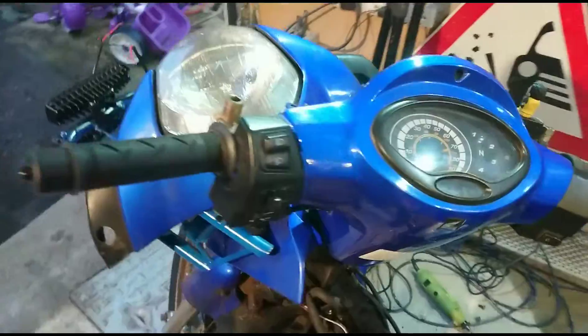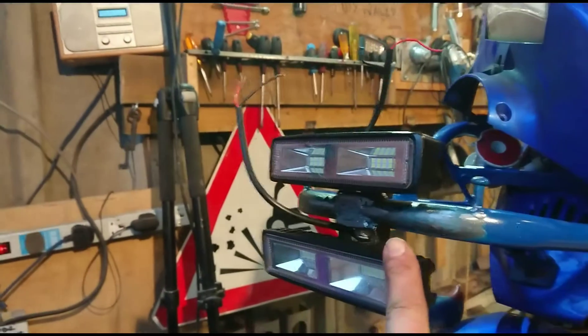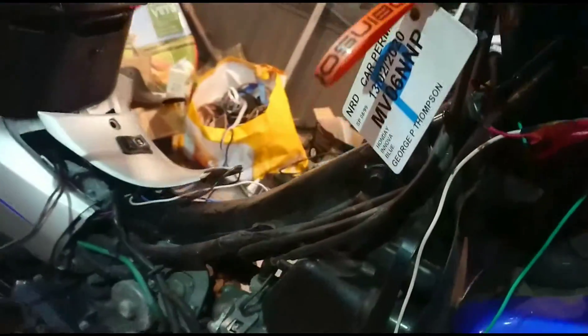So I will slowly explain what I've done. I didn't want all of the lights to be on all the time so I've had to sort of work around all that. I've got the Innova in bits. These are the rack that I made — teeny tiny rack, it's kind of solid. I've put a massive weight on it and it's really strong, I'm quite proud of it. And these are the spotlights I want to use — I've tried them with a really old battery and they're super bright and cool. So I've pulled all the bike apart and what I have is: an earth there and a positive there, going through the tray, and the positive will feed this relay here, which is running off the ignition switch.